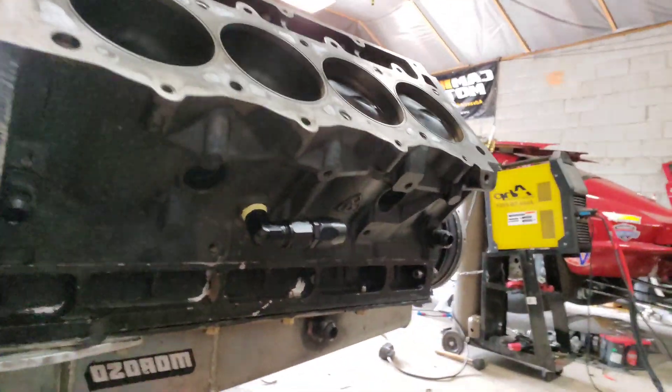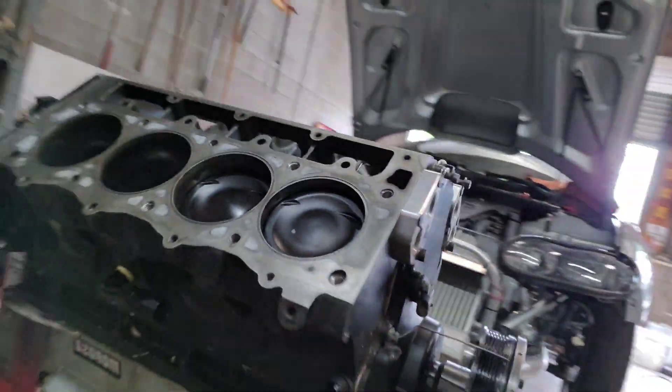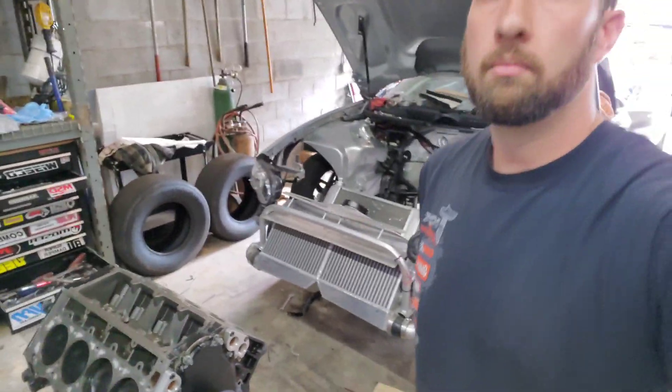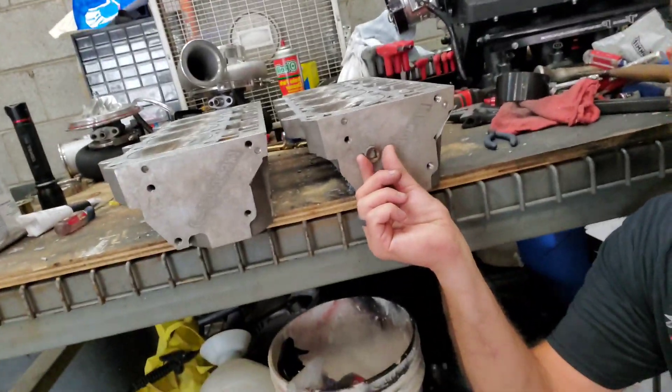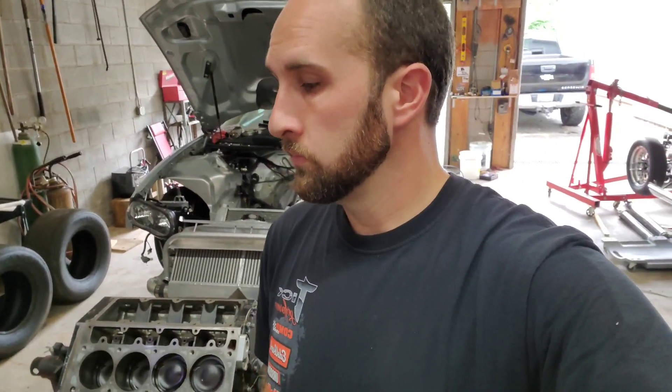I had to drill and tap a hole in the side of the block, and water will come out there. I'm going to put water in the block the same way it did from the factory, but I had to have a way to get it out. Same thing for the heads — I drilled a hole in the back of the heads. That's just a plug right now, but I'm going to put a 90 degree fitting in there. Water is going to flow in the front side of the head and out the back. I don't think this thing will have any cooling issues whatsoever — it's going to be a lot of water flowing through everywhere, just not the surface of the heads and the deck. Should work pretty good.